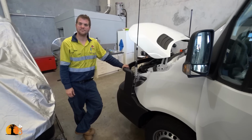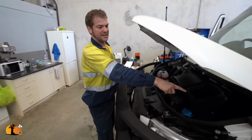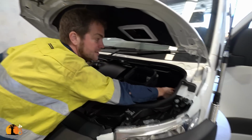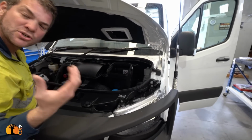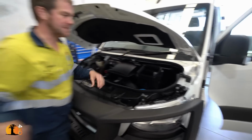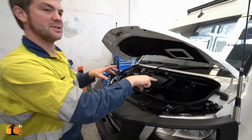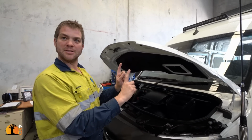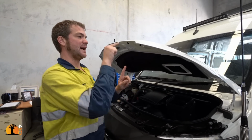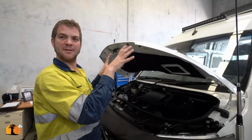Now explain to me, it has a shore power system. Can you explain that to me? Absolutely. So we have got a connector under the bonnet here, like you find on caravans. So you can plug in shore power, means the grid, here, and that cable is connected to an automatic transfer switch. Also connected to that transfer switch is the inverter, and the output from that transfer switch goes to the electric installation in the vehicle.